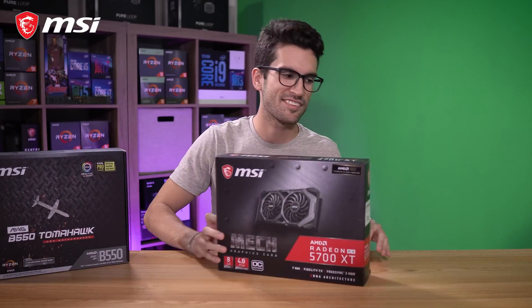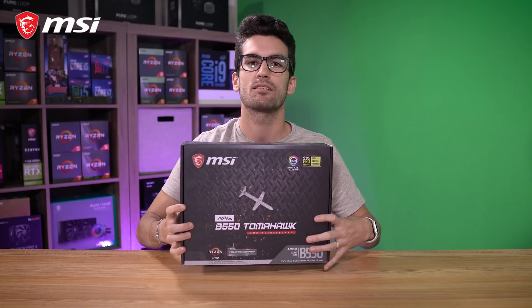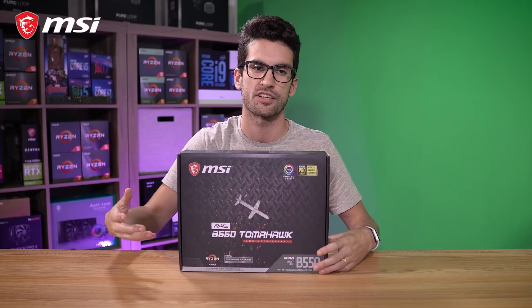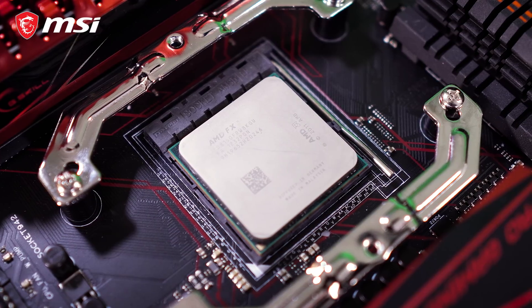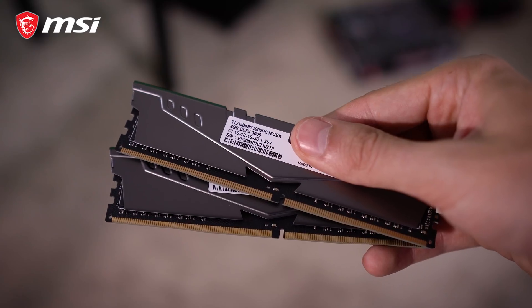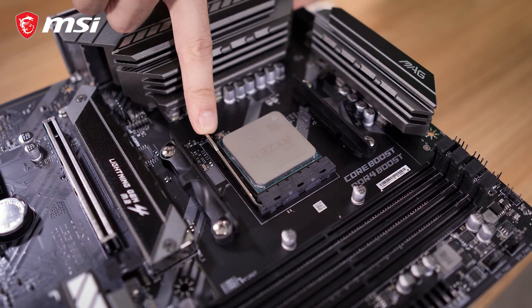The easier of the two upgrades is out of the way. Now let's assume I want to upgrade platforms — and what I mean by that is the motherboard, the CPU, and potentially the RAM. In this demonstration we're using the exact same system, so we're going to be actually removing the graphics card we just installed, but bear with me. We'll be upgrading from an AMD FX system to an AMD Ryzen system, which means we are replacing all three parts: the motherboard, the DDR3 to DDR4, and the CPU. Compared to graphics card upgrades, platform upgrades require much more effort.